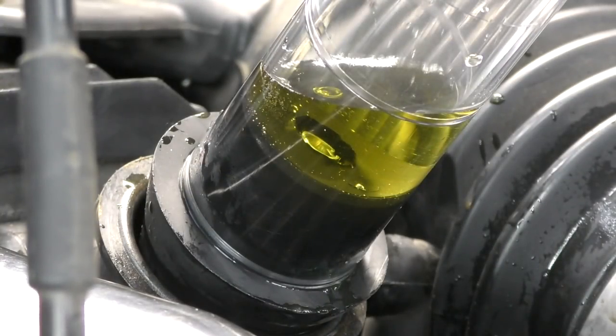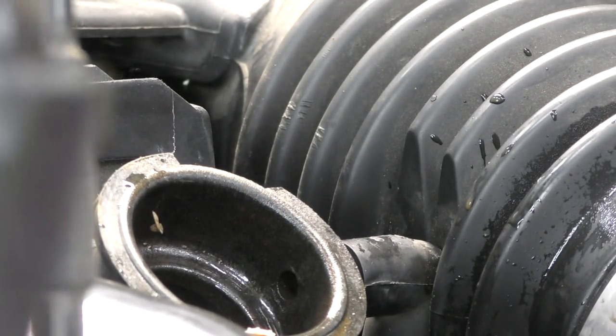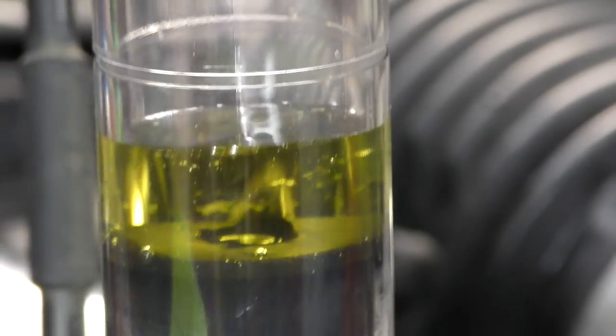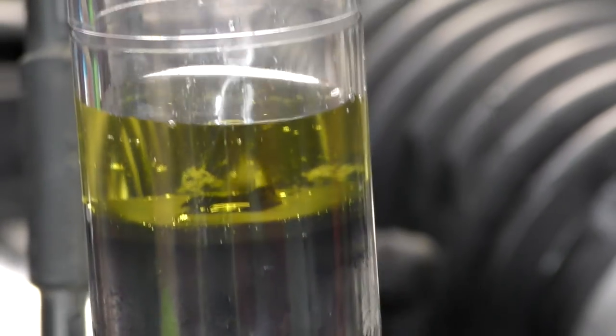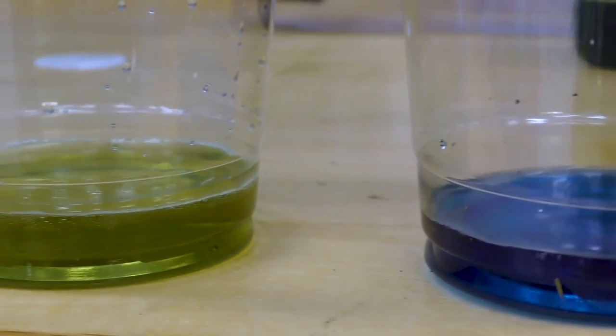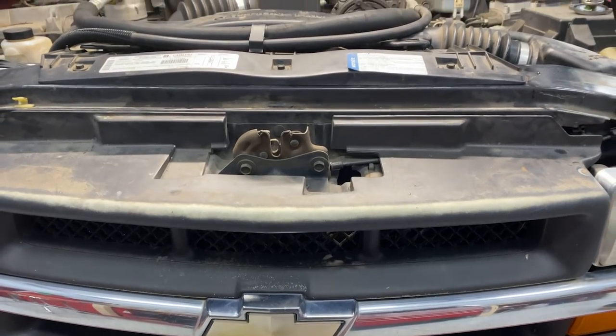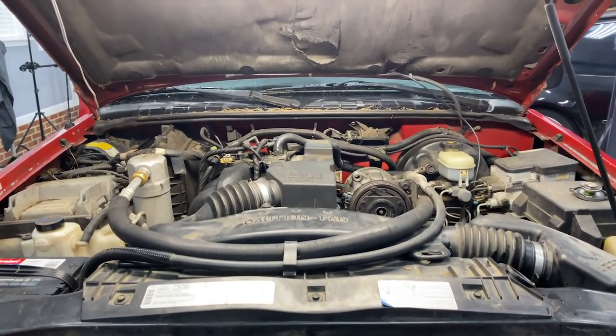After letting the truck run for about five minutes and then pulling vacuum through our tester for about two minutes, as the instructions say, I think it's pretty obvious that our fluid turned yellow. This is the color that the fluid was when we first started, and now you can see it's this pale yellow. So we ran our test, and as you saw, that fluid turned yellow super-duper fast. I really like these combustion gas testers, whether you use the one with the bubble on it or this one hooked up to engine vacuum or with the hand pump. It's a great test to run — it's super fast. That changes colors in under two minutes, faster if it's really bad.